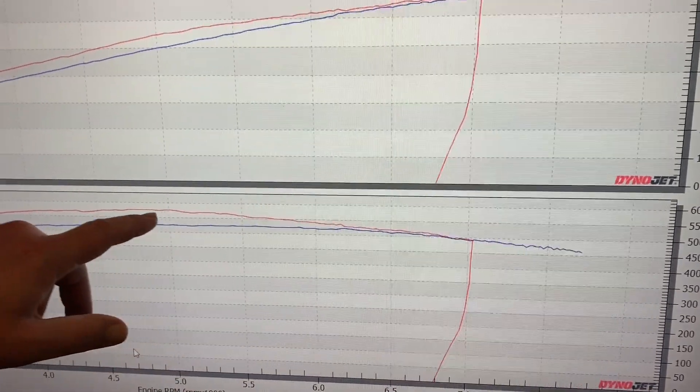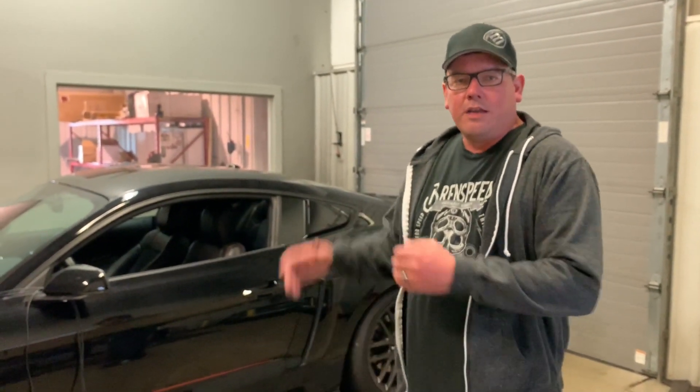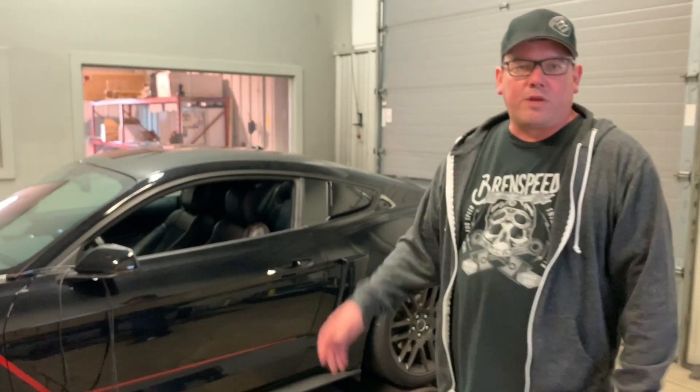I'm really impressed. With this new calibration and redesigned kit I was curious where torque would land — and 576 pull after pull is awesome, especially since we see a lot of 530 rear-wheel torque figures, and even GT350s with a supercharger typically come in around 530. So retaining the warranty and being 50-state legal is a big deal. Next step: I want to get out to the track when tracks open up, put on some sticky tires, and see how that warranty-backed power performs in the quarter mile.